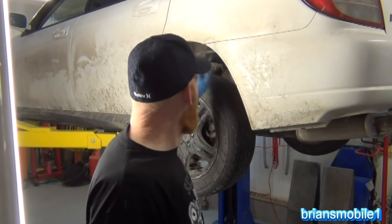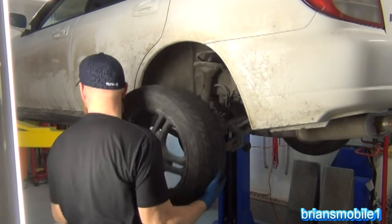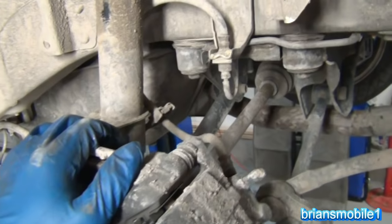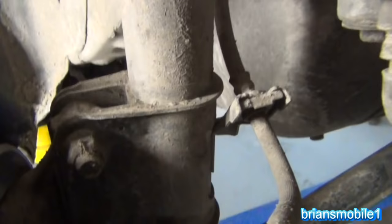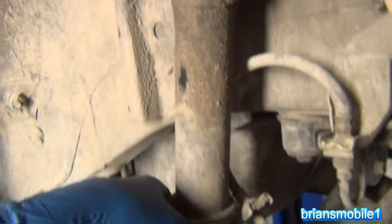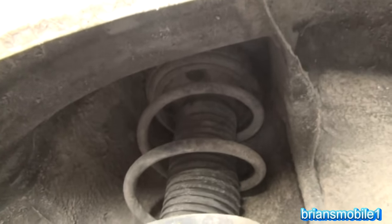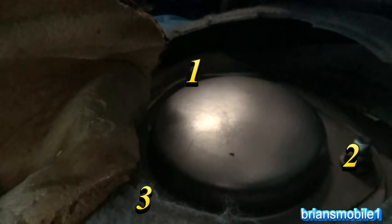Maybe you ought to take a look at your car today. In the meantime, let's get this wheel out of the way and see what's going on here. This is a great example of how to replace a strut because it's a very common design. You've got just a little clip that holds the brake line in place, the two bolts here and here on the strut base, and then the bottom half is free — and then you just have to pull the mount from the top. To access the top of the strut mount you have to go in through the back door, pull up the tab, and back where your climbing gear, ski poles, and everything are, there's a little access. Pull that up, remove the sound deadening insulation, and you'll see the three bolts that hold the strut mount from the top.